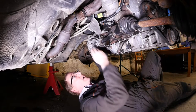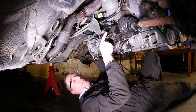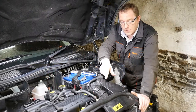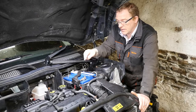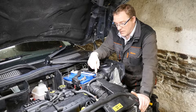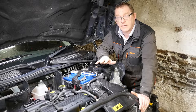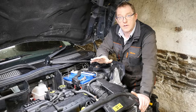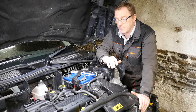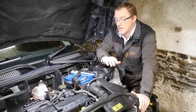Hi and welcome to this video where I've reconnected the gear linkage cables, popped the starter motor back in, put the heat shield on, the air filters back in, the battery and the battery tray, and also the ECU. In the next video it should be a case of putting the subframe back onto the car, or possibly looking at those rear bushes — I might change those just before I put the subframe back on as a bit of a precaution, because they do tend to fail the MOTs.